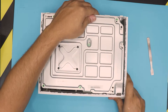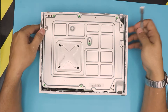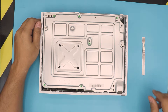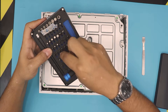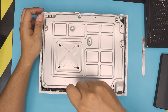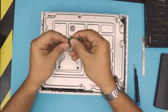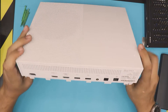At the bottom there's a metal bottom cover — pretty much everything is inside here. To remove the top plastic, we need to remove the green screws. Those are F-screws identified as F3, F2, F1 — there are actually six of them total. I'm going to use my iFixit toolset and we'll be using Torx number 10. Remove all six of the big long green screws.